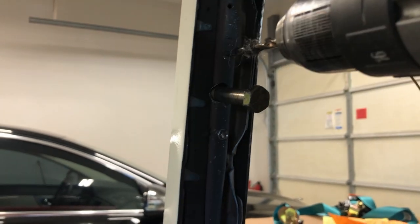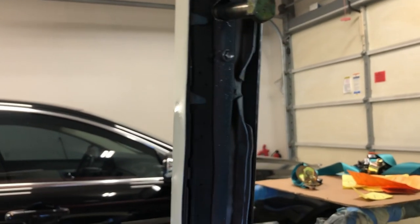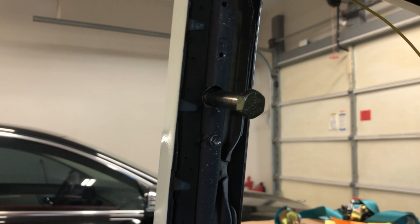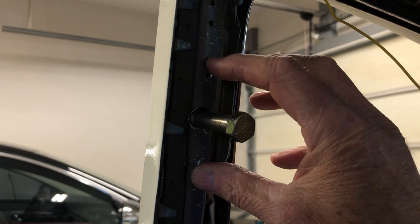We've got this plate in place where it needs to be, behind the B-pillar. I'm going to drill and tap, put in quarter-twenty bolts to hold that plate in place. When we put the final seatbelt in place, it'll just stay there. I've got one quarter-twenty bolt tapped in - this is firm. I'm going to tap in this other one too - drill it and tap it.